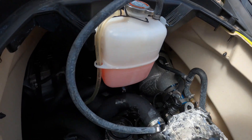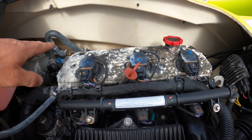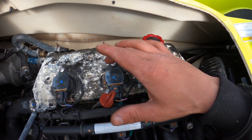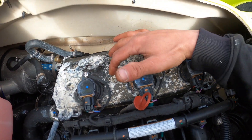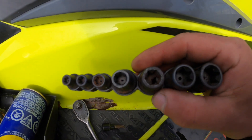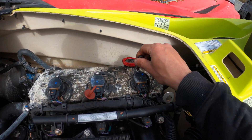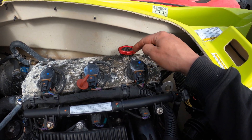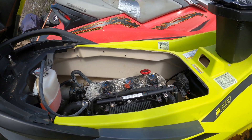So like Dave said, this looks like crap. What we're going to do is change this valve cover. First we disconnect the wiring for our coils, then we take our coils out. It's simply a matter of these six Torx specialty bolts — you need a set of Torx sockets and a T30 to do this job. The T30 is a little bit loose, so if your coil bolts are super tight there may be a specialty tool, but a T30 will work.